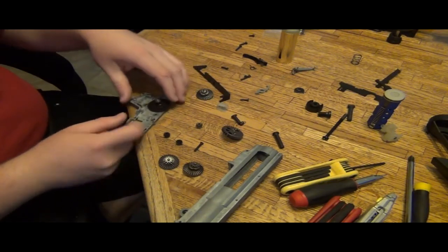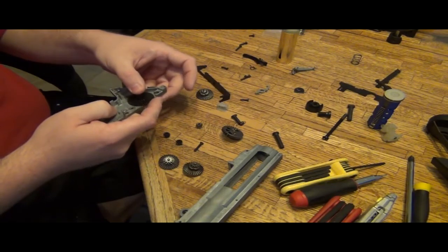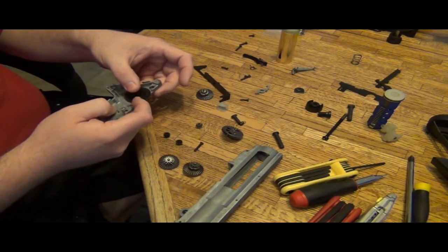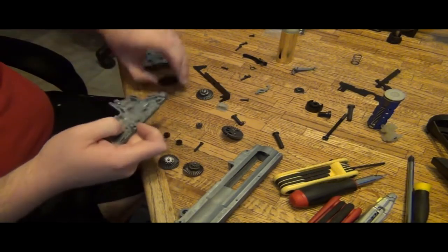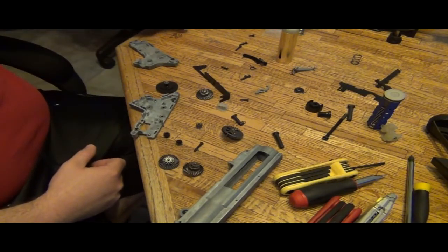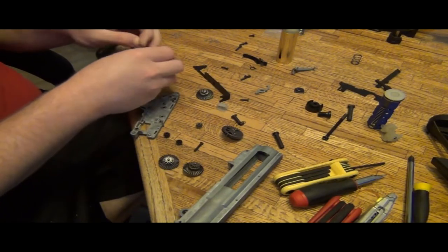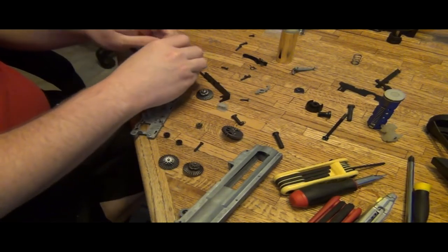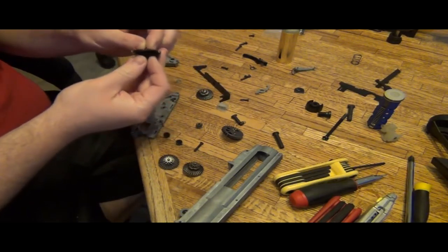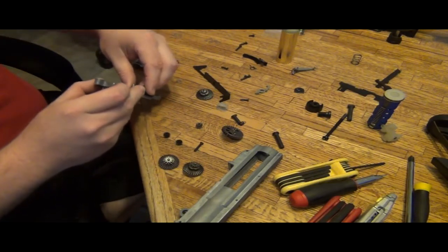So putting this in, this is a grinding effect, even when held in the middle. See, look, I'm holding down the middle, and it's grinding right here, you can hear. And see that it's grinding right there. So I'm just going to throw on a 0.2 just to avoid the grinding for now. Let's go ahead and take off the top shim because I don't care what it is. All right.